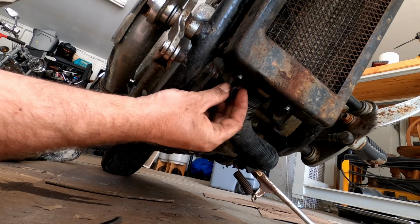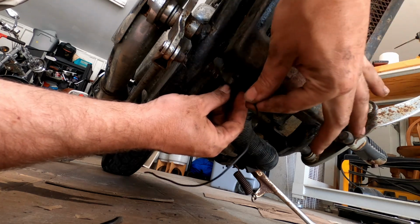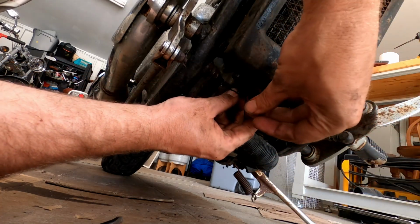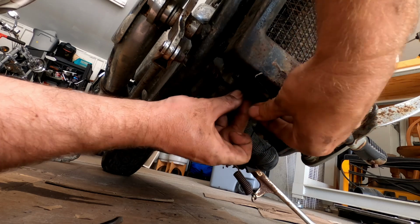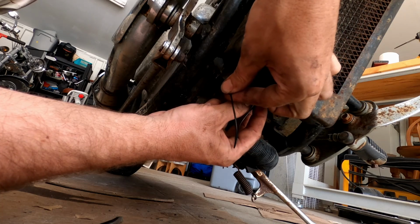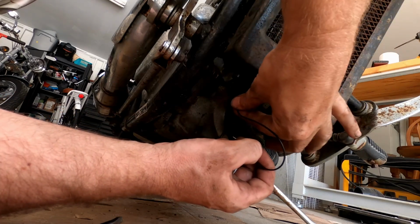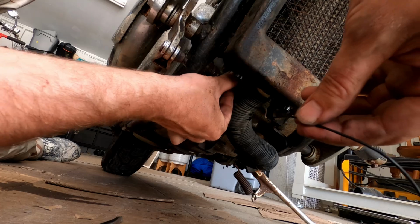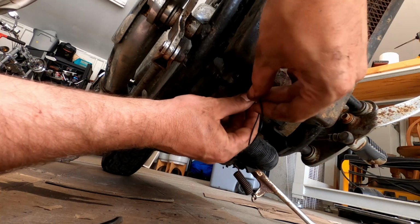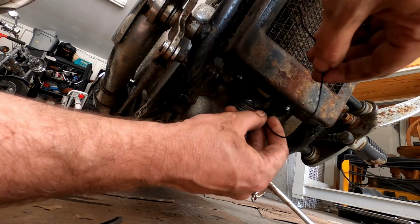So here's what actually goes into my fan. The back side of this radiator is the actual temp sensor that's supposed to go to ground once it reaches a certain temp. I believe it's 200. So I'm gonna go ahead and ground this out to the chassis, if I can get a good contact. It's already cooled off enough, but it did kick the fan on once I grounded it.